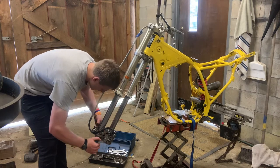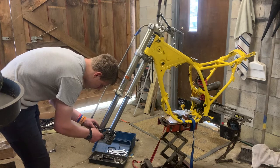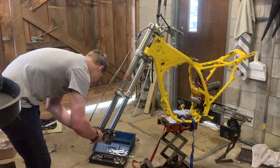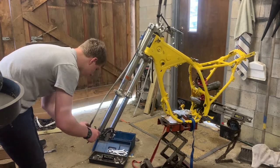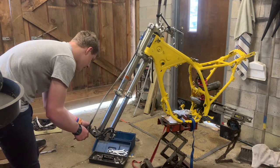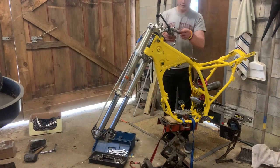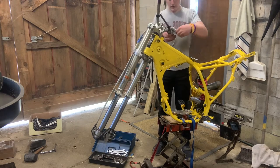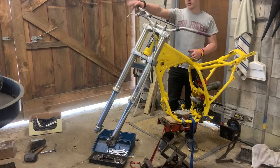Okay, so now this bolt comes off, and this little clip goes under it. Clip goes through there, and into there. And then there's these little 8mm guys on the front that hold this plate, that hold this thing down under it. Okay? So now, I'll snug this up a bit more so it can't slide off. And I do not want to squeeze this brake handle. Okay. Front brakes are installed.